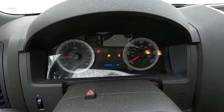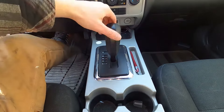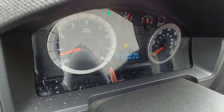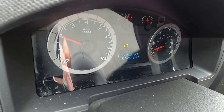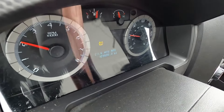At this point, start the car and you can do one of two things. The Ford manual recommends that you just run it for three minutes, cycle the gears, shut it off, and drain the fluid. What I did was drive it around the block. I changed the fluid with the car warm just like I would with engine oil, but it had cooled off a little bit, so I essentially drove the car around the block, let it warm up, shift through the gears, brought it back, cycled the transmission, and then drained it.